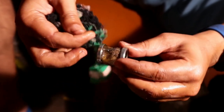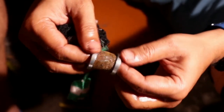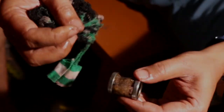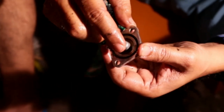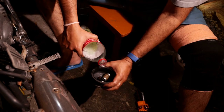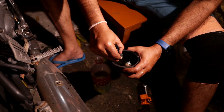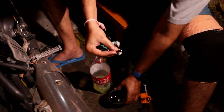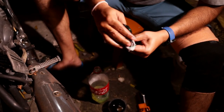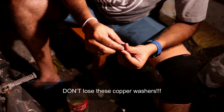While the oil drains, clean the pre-filter with some petrol and let it dry. You can use either petrol or diesel, but if you do use diesel, make sure to dry the parts out completely before you put them back on the bike. The primary drain bolt and the drain bolt with the pre-filter both have a magnet and that should be wiped clean with a clean cloth.